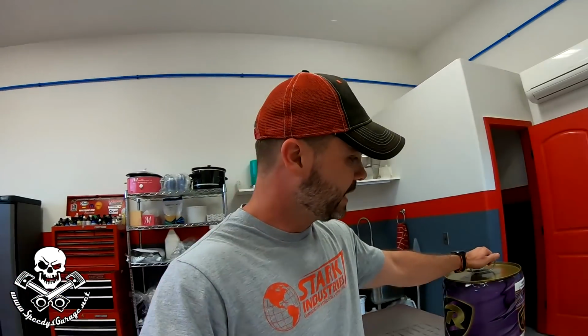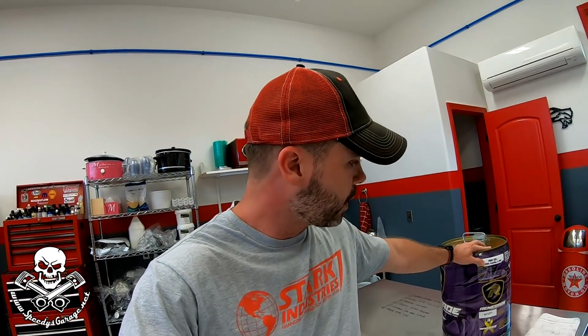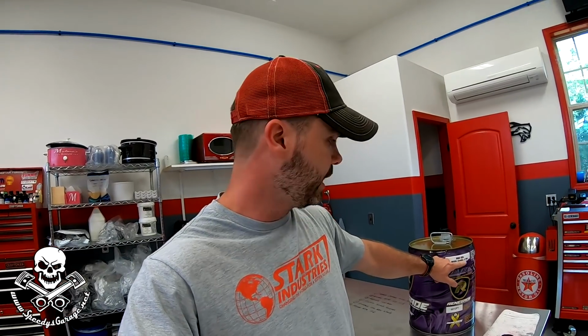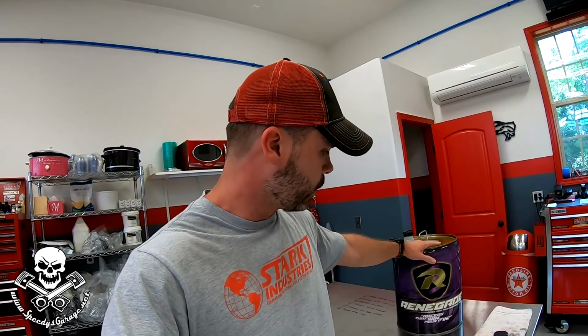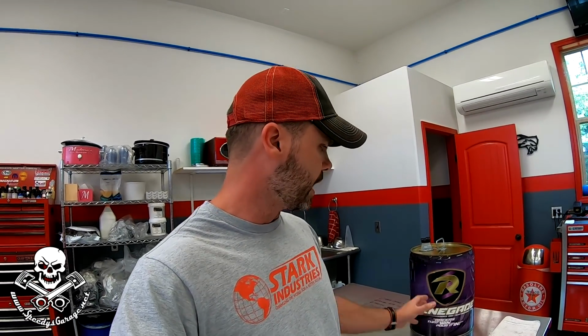What we're gonna do is start by raising the octane. I've got some Renegade race fuel. It's 112 plus octane. I've run the car down where there's only a couple of gallons of 93 left in the tank. I'm gonna pour in 5 gallons of this 112. I'll go online and find a calculator to determine exactly how much to add, but my goal is to get it between 101 and 105 octane, somewhere around in there.